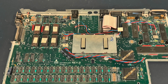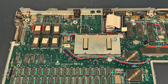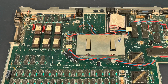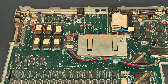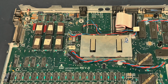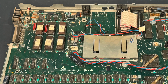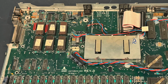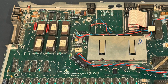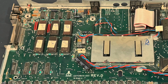These range from an initial TOS 1.0 or pre-TOS 1.0, where only part of the operating system was in ROM, and then some of it had to be loaded from a boot disk. Atari quickly transitioned over to all of the operating system in ROM, and shipped with TOS 1.0, 1.2, 1.4 for the Atari STFs, and then for the STEs, 1.6 or 1.62, which had some bug fixes in it, and then 2.06 in general for the STEs.